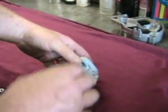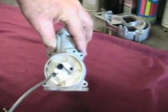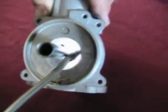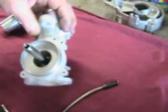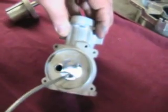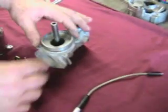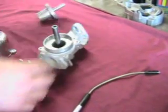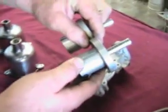When this is assembled, the air holes are at the rear of the piston — here and here. Whereas if we put in this piston, which is from an MGB HS carburetor, then our air holes are on the side. And they will not allow the piston to lift, causing the carburetor to run way too rich. Something you might miss if pieces have been mixed and matched.